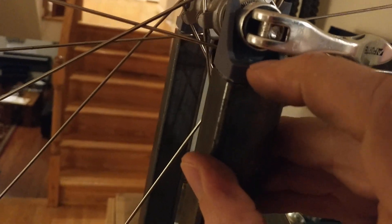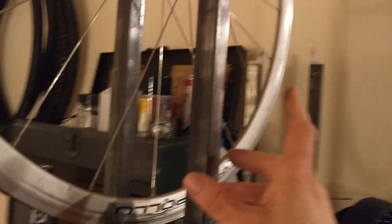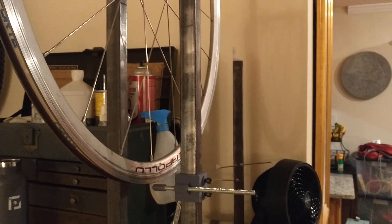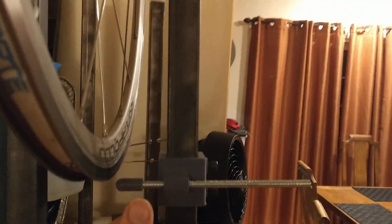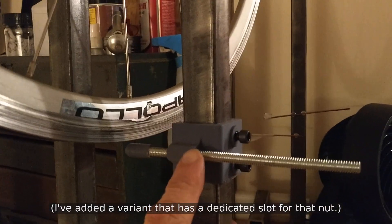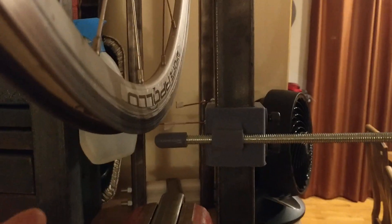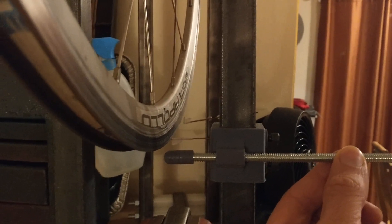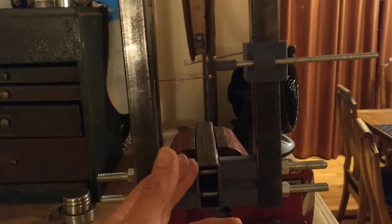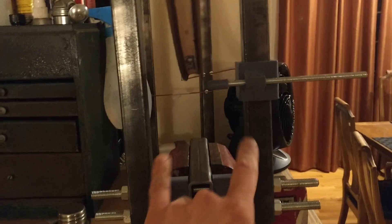If you can't get steel at all, then I have another screw hole here on the top, and that means you can replace this whole piece of tube with a piece of 1x1 hardwood and then screw it in from the top — just cut the plug off and screw it in that way. You can get a piece of 1x1 by 3 foot oak at Home Depot for like $4.00, so cut it in half and get the same thing. If you don't have the quarter inch tap to make the threads, either just drill it out and use a smooth rod, or glue a quarter inch nut onto one face and thread it in that way. I'm not terribly happy with the play in this threading anyway, but it does well enough. If you can't get the 1x2 inch rectangular tube to mount to your vise, just get a piece of 2x4 inch lumber, and as long as you adjust your spacers, everything can still have the right spacing.